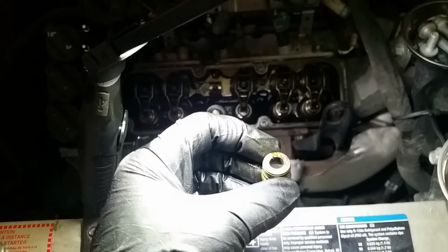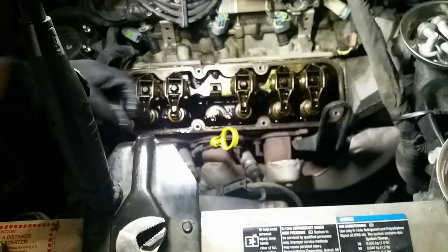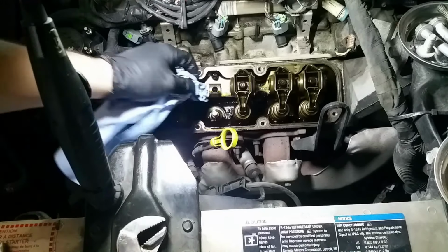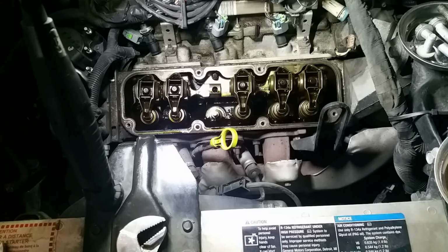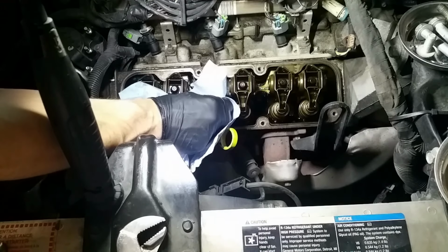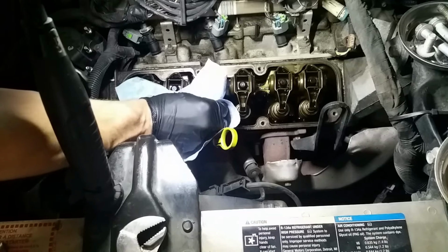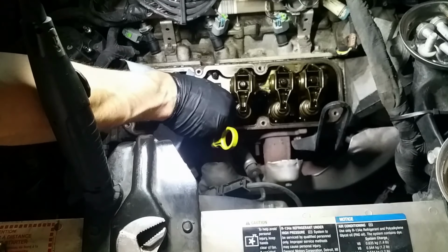That means oil's been getting down in there, and most likely down into the valve itself, because it's going to slowly go past the guide on the valve and work its way into the cylinder or into the exhaust. Somewhere, somehow, it's burning it or losing it, either through the exhaust system or burning it in the cylinder. So I'm going to replace these seals with new ones in the hope that it solves the oil burning problem. Right now it's been burning about a quart and a half every oil change,